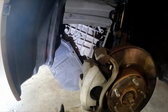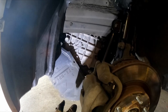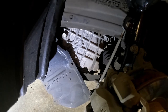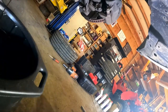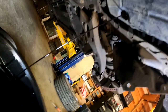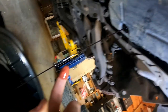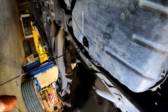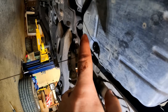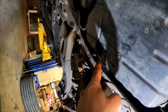Once the fill plug is loose and you can screw it on and off with your fingers, we're ready to go. Now we can go ahead and pull the drain plug and then the level plug out to drain the transmission, then take the oil pan off and change the filter. You'll need a 6 millimeter hex to pull out the drain plug. The oil is really really black — it's long overdue. I'm a little over a hundred thousand miles. I bought the car at over a hundred thousand miles, not my fault.